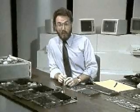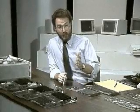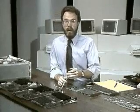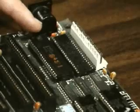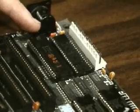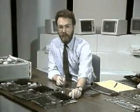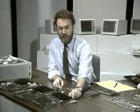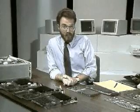Let's start with central processing units. They're the things I've mentioned a few times, called CPUs. Over here on the XT, here's the Intel 8088. It's the heart of the XT. Recall that I've mentioned one of the characteristics of the CPU is something called the CPU's megahertz. Megahertz is the speed of the clock circuit that drives the CPU.